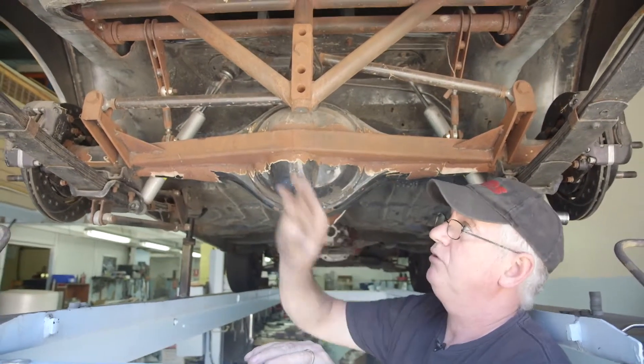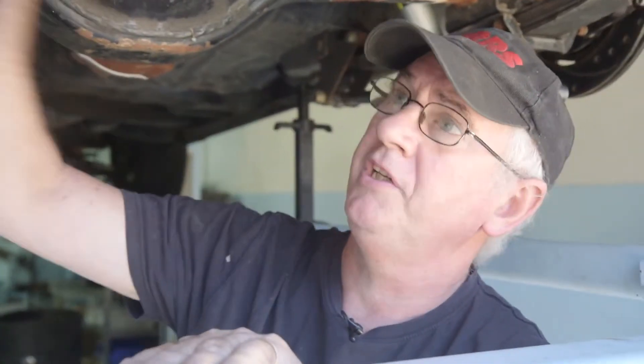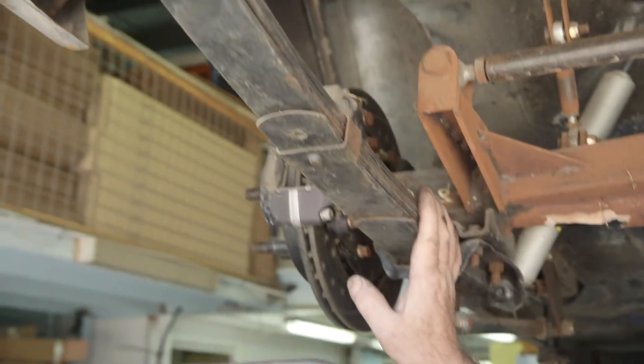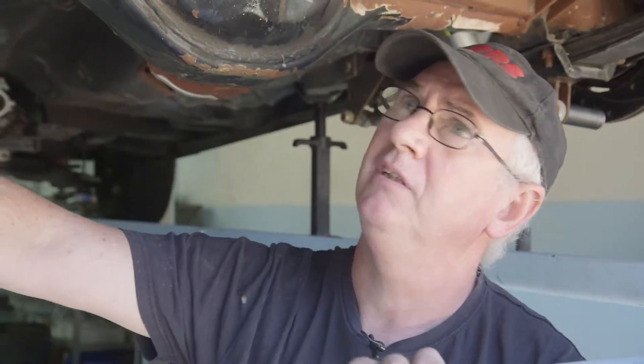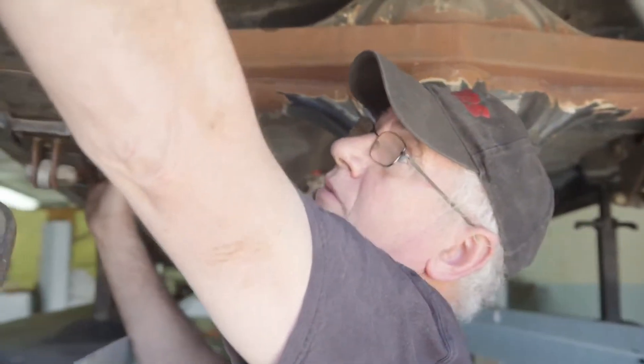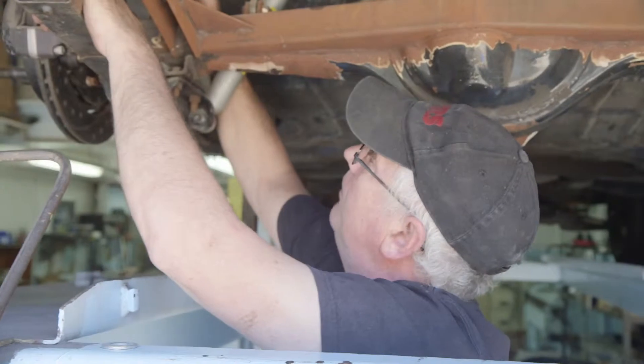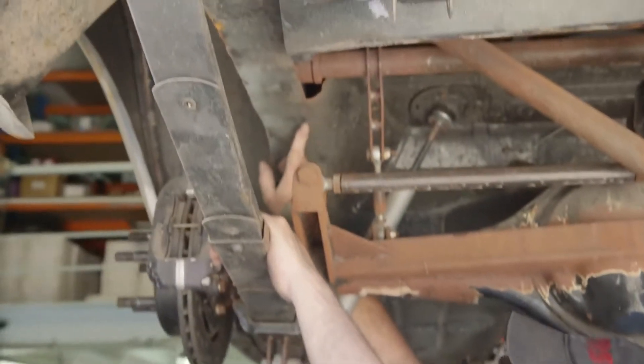So let's go through the exercise of correcting all of this and making a bolt-in three-link. Now, even before all of these modifications were here, Holdens and Fords had this leaf sprung setup. The problem with a leaf sprung rear end is that as it compresses it produces a characteristic called roll understeer. You'll notice at the back here a shackle — as that moves up, this moves back. It has a stop on this Holden so it can't come over centre.